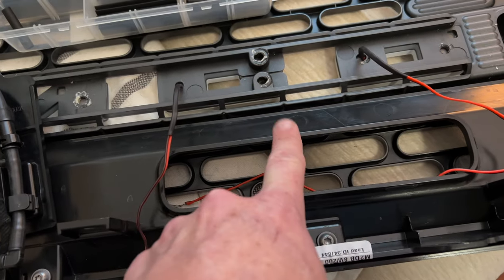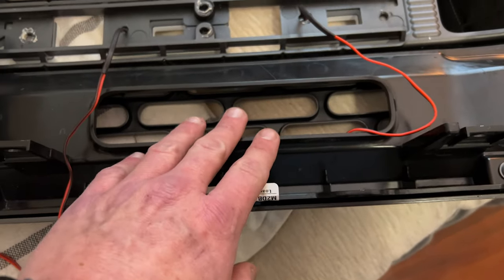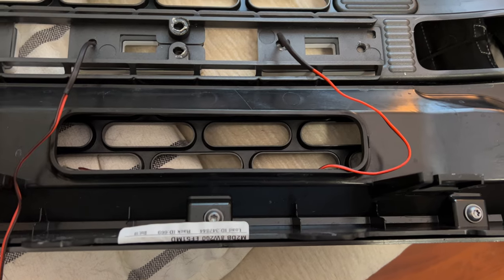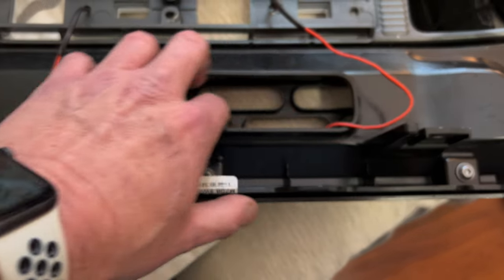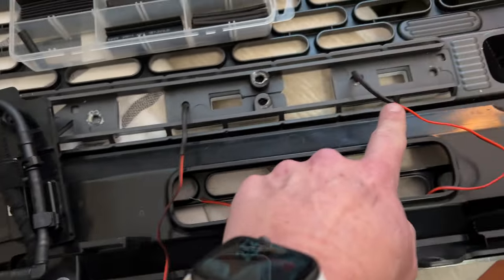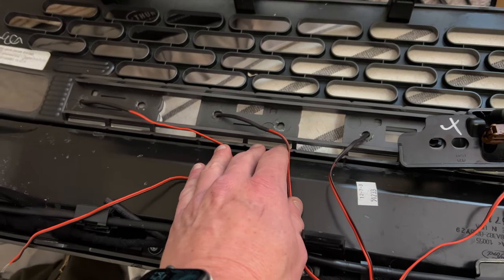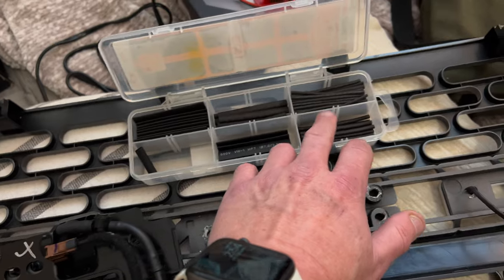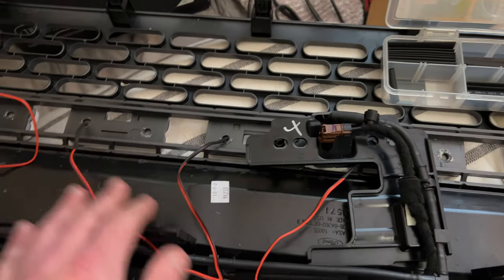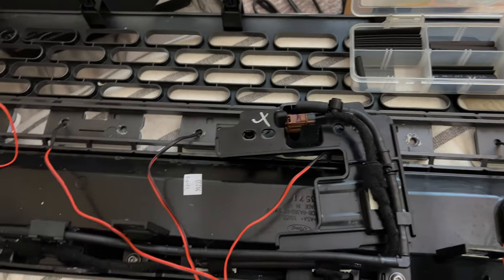I'll also need to put an adaptive cruise control bracket right in this area when I do the winch plate — according to the 80D directions it goes somewhere in here, so I'll probably have to trim some of this out anyway. I'll add extra heat shrink tubes on the ends and maybe even the second-to-last one so there's no red wire exposure as things run over there. I'll put a lot more of these little heat shrink tubes to make it all black until it gets closer to the end, so it'll be discreet — you won't be able to see it unless you're looking for it.